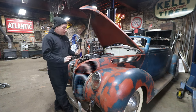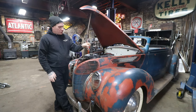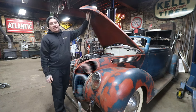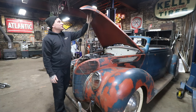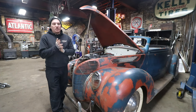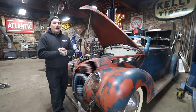They also had literally a piece of electrical wire shoved through one of the louvers here, and that's how you'd open the hood. We're going to do a little better than that. And the safety catch is broken off on this thing, and the little pin has no spring. It just pushes around. So all of this stuff is really bad. It's a recipe for disaster if you're driving more than just 5 or 10 miles an hour down back dirt roads. I wouldn't trust it.